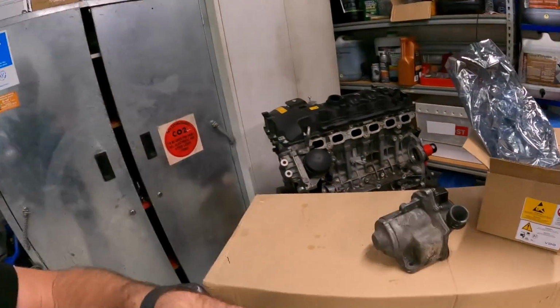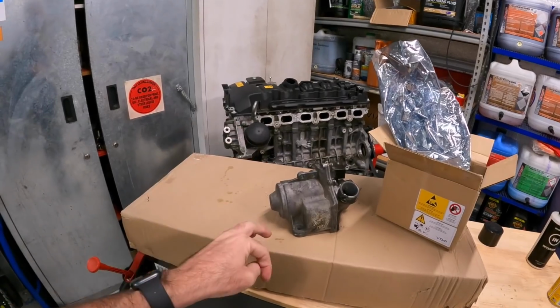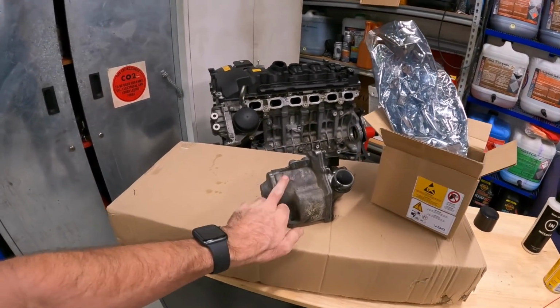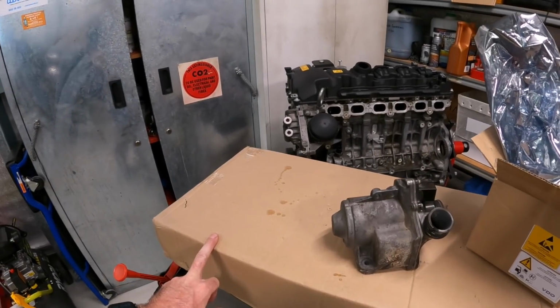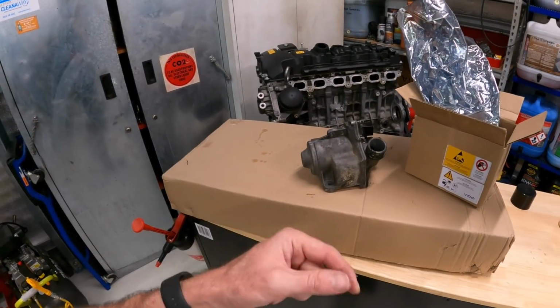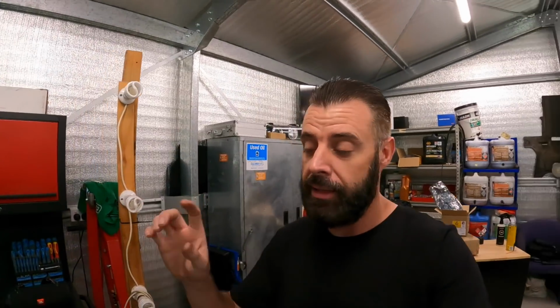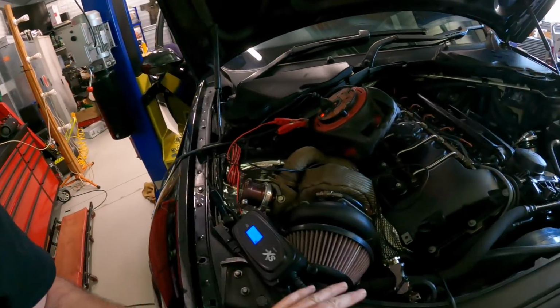We actually fitted it up last night, reconnected everything. Before we even bled it, we waited a few minutes to see if it was going to automatically turn on like this one was doing. Because, I don't know if you've been following along, but the BSD fault, I think that was the issue. This water pump is on the BSD circuit, and any of the components on the BSD circuit, so that's the water pump, the alternator, the battery voltage sensor, and the oil level sensor, those 4 items are all on the same bus, and any of those being faulty can cause your water pump to turn on. So we've sort of worked out that we're hoping it's the water pump. It appears to be the water pump. This new one has not automatically turned on last night or this morning for the half an hour I've been in here.